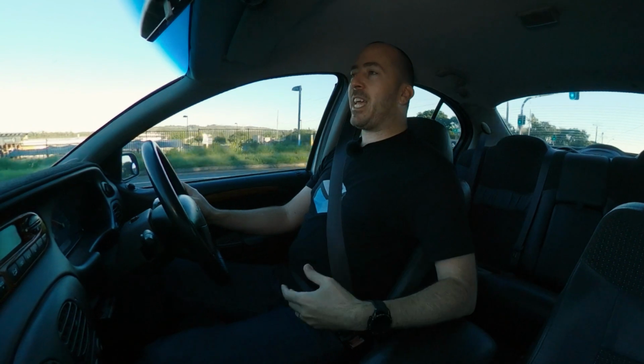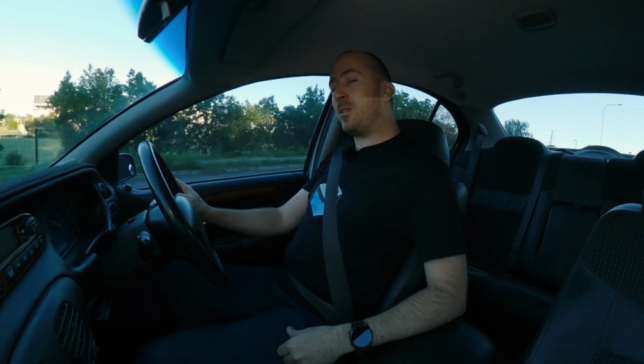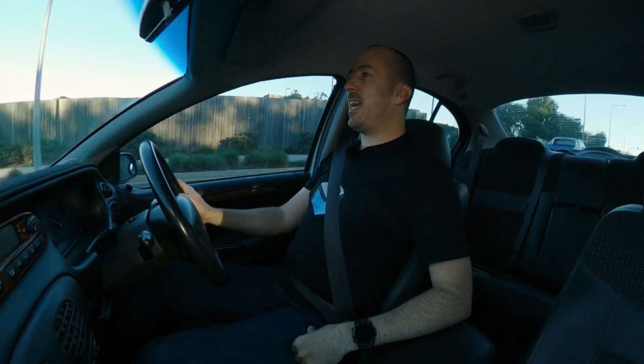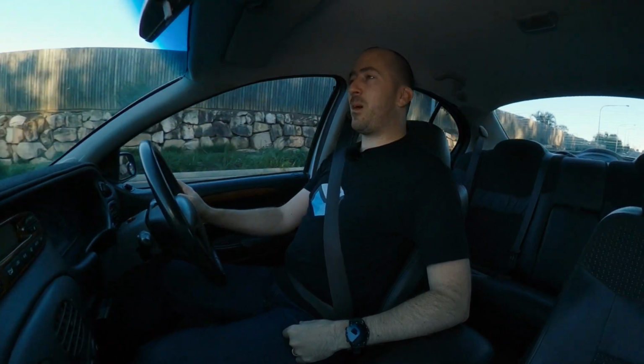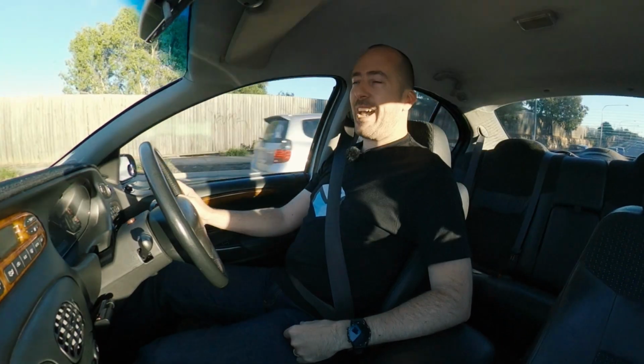And I ran the car again, misfired again, and I pulled the plugs. No surprises, but cylinder 1 and 2's plug at that time were heavily sooted. I'd cleaned them all up previously, and yeah, the plugs on 1 and 2 were sooted really heavily again. So it appears that my El Cheapo set of eBay no-name injectors were possibly not flow matched at all.